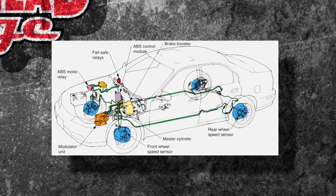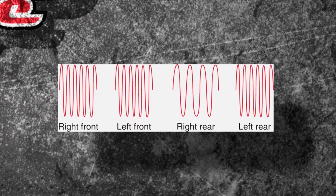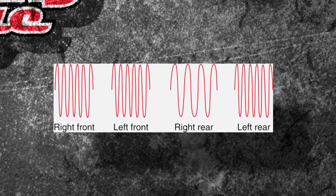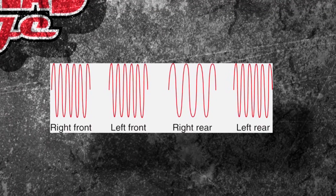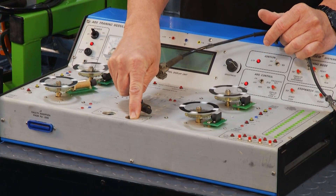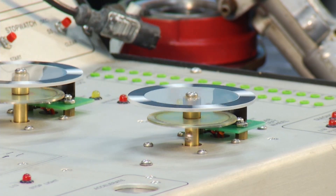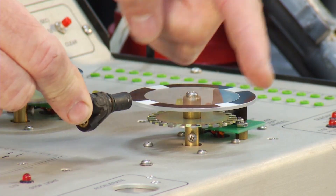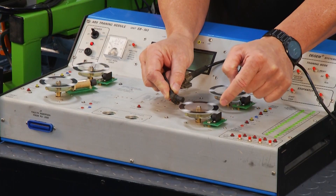How does it work? It uses wheel speed sensors and looks at each wheel. You can see the right rear starting to slow down — if that right rear starts to slow down, it can go ahead and start pulsing the unit, put it into an ABS stop, and get that wheel under control. Here with these wheel speed sensors: all four going at the same speed, everybody's happy, the ABS unit's happy. If one slows down, the sensor picks that up and tells the computer, which then gets that wheel under control.